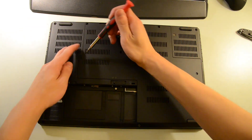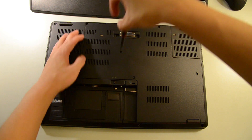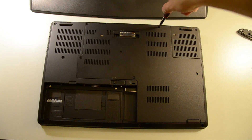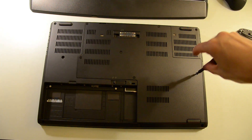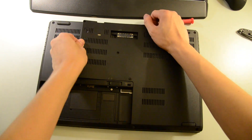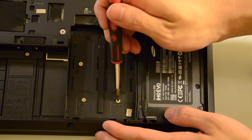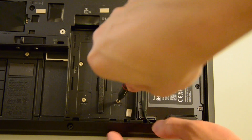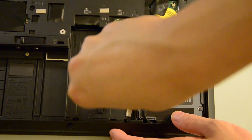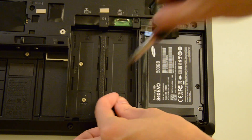So now let's disassemble the system. Once you see your M.2 bays, you want to remove the one screw that's been included in the bay, and we'll use this to attach the plastic M.2 tray that we just purchased.